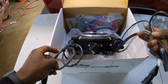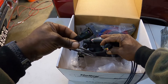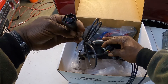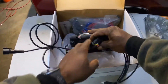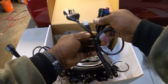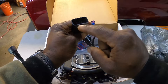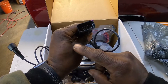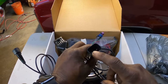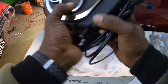You have several pigtails. This one is for your wideband O2 sensor — it might be a 4.2 or 4.9 connector, kind of hard to tell by the plug. You have your other two plugs: the display plugs in here, this goes to your coolant temperature sensor, and this one — if I'm not mistaken — is for the expansion connector so you can do AC request and things like timing. This is going to be your main connector with your power, ground, and all the good stuff.